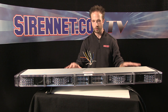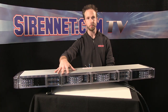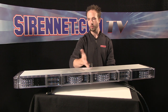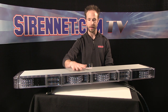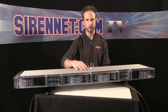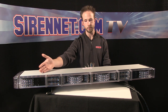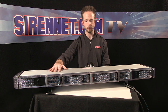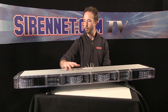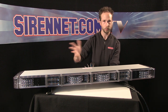I'm going to flip the bar over to give you a look at the back, and again there are trigger wires to operate the back portion of the bar. Now that the bar has been spun around, you can see the back combines rota modules and the classic dual-stack linears. With the bar being the classic Whelan modular system, if you ever need to change anything or rearrange components, or when you order initially, based on size and colors, you can have more rota beams, less rota beams, linear modules, or no linear modules — it can be built from the ground up. Or if you're doing it on a large fire apparatus, you can get it in a 72-inch length chassis, with the back all cleared out and the front fully loaded with linear modules and rota beam modules for plenty of traffic clearing, lighting, sweeping, and flashing.